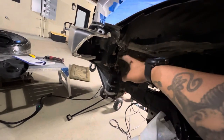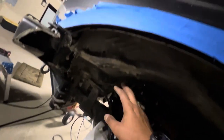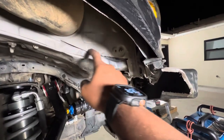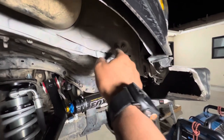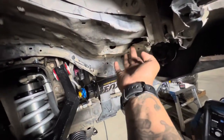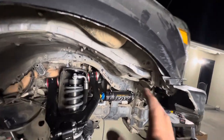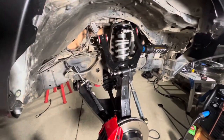With that, I'm able to leave quite a bit of the structure here. I'm gonna get everything finalized, finish the whole truck, drive it around, see how it performs. The way I cut this — I just put a seam, cut it right here, cut it down so I can bring it up. I'm gonna hammer this into this and just start tacking it all in to build it back up a little bit, then patch it up. All this stuff right here I'm just gonna trim out of the way.